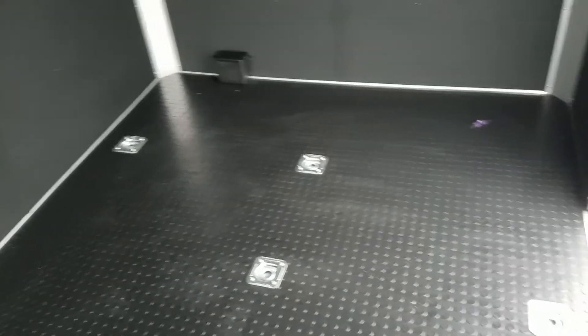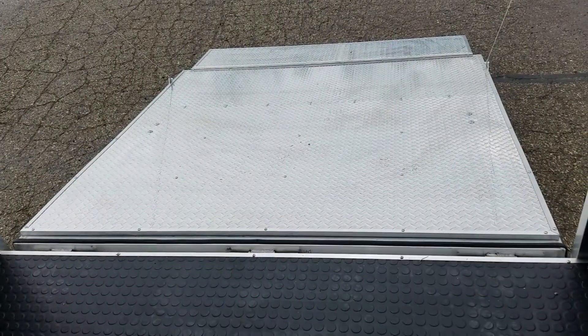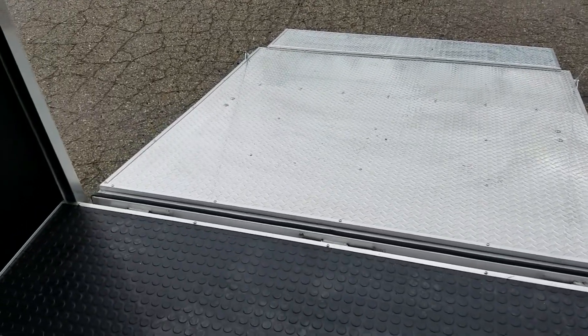Our structure is a huge part of what we do. This particular trailer has 3/4 inch center wall studs, 1x1.5 inch top rails, and 1x3 top rail. A lot of our competitors use 1x1 and an inch-by-inch-and-a-half top rail with 1x1 roof bows — we definitely won't build anything like that. Structure is a big part of what we do, and if you buy a trailer you want it for the long term. This model has 1x1.5 inch roof bows 16 inches on center. Cross members are two feet on center. The mainframe is a 2x3 and 2x5 double hollow, same as the tongue. The ramp door uprights are less than 16 inches on center. All the corners are 45 degrees so there are no open tubes, no caps — it's finished off nice.